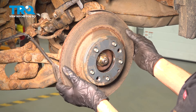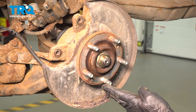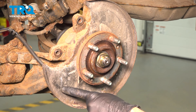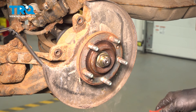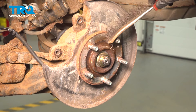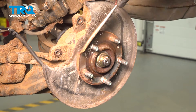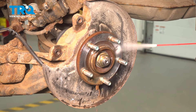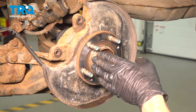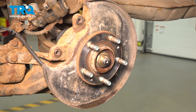Break the rotor free and remove it from the vehicle. Once you have the rotor out of the way, the next thing that we need to do is clean and inspect the mounting area on the wheel bearing hub. It's also a good idea to check the backing plate. Once you feel as though you have this cleaned down and you're sure there are no raised areas on the mating surface, continue on with some anti-seize.